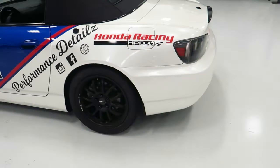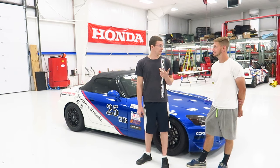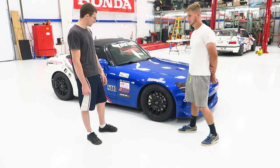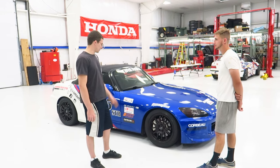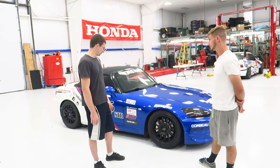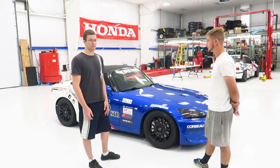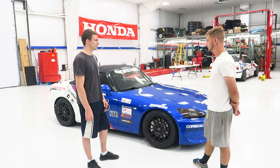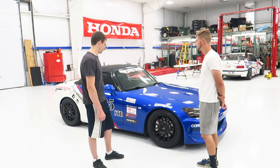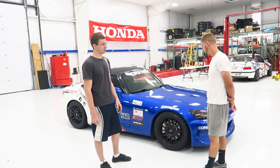Here with Darien today — he's got his S2000 in the shop. He's been detailing a lot of the cars in Steve's collection, so today it's time to give back. We're going to get his car on the rack and give it an alignment and corner balance, fix the caster, and then go after the brakes. This is a brake package made at 3R — we're going to make a reinforcement bracket for the caliper to get the brake pedal more consistent, test some different rear pad compounds for more bite, and the car is currently a little pushy on entry.